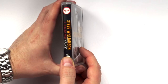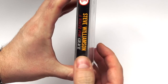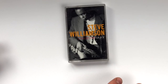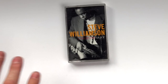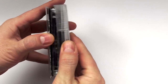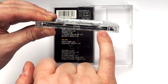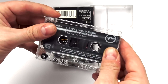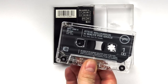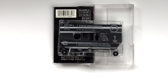Let's see why I took this tape out. As you can see here, it says CHROME, which means — or should mean — that the tape adopted here has a chromium dioxide typology of compound on the film of the cassette. In most cases, you're not going to have a true Type 2 chromium dioxide tape, simply because the little notches here are all the way on the sides. So this is a Type 1 cassette, physically speaking.